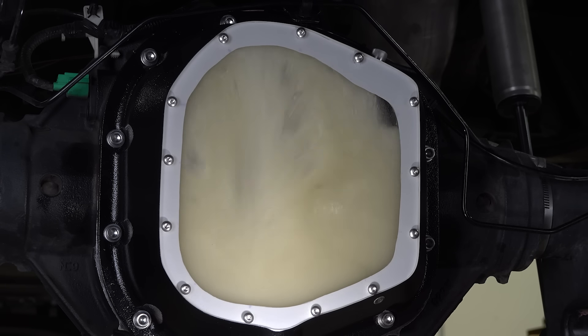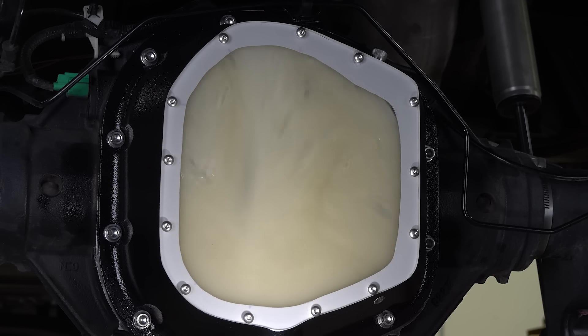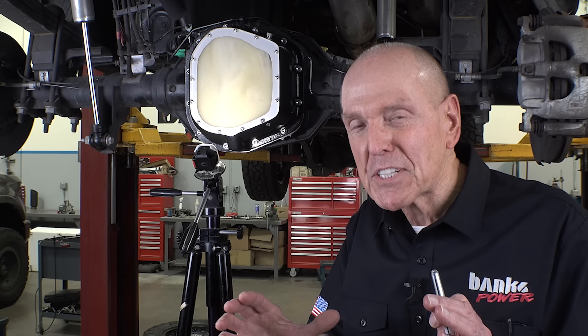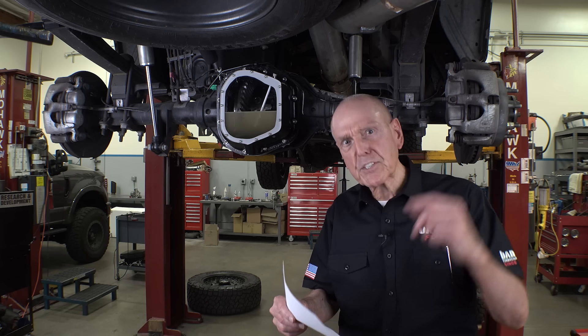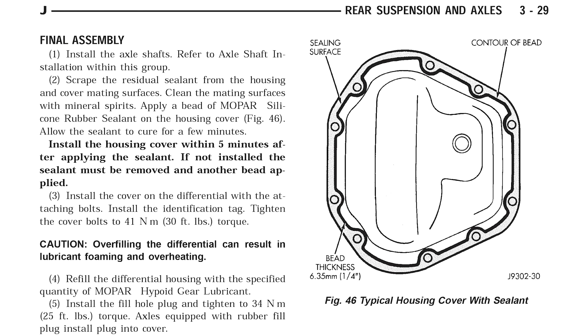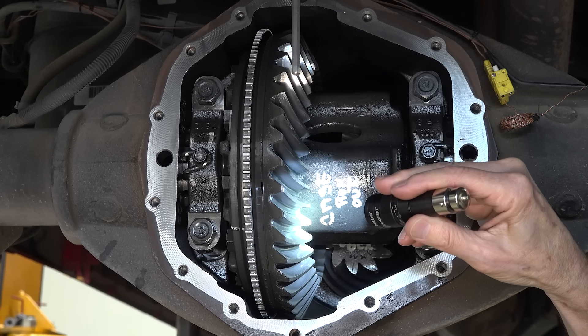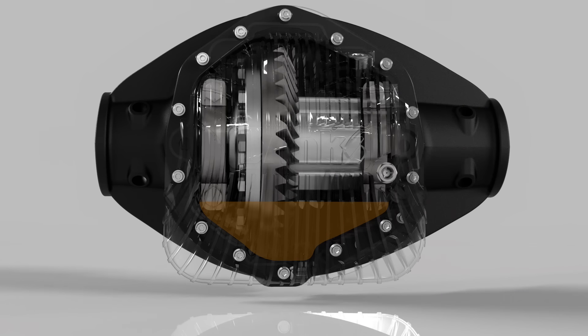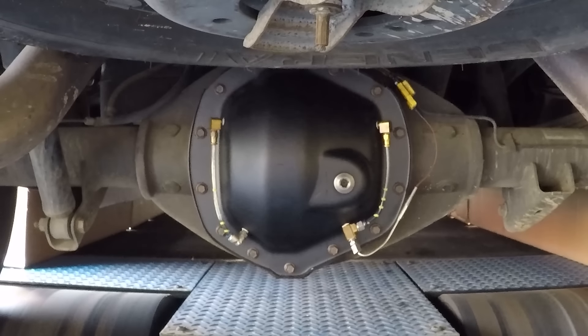70. My only comment here is this is dead wrong. There's this old wives' tale that overfilling above the stock fluid level is the thing to do — I'm calling bullshit on that. Even in the Jeep manual they address it. Caution: overfilling the differential can result in lubricant foaming and overheating. For efficiency, the gears and bearings would prefer the lube to be right around 200 degrees. Anything more than 200 and you're taxing the base oil. The reality is many diffs can run far hotter than 200 degrees.